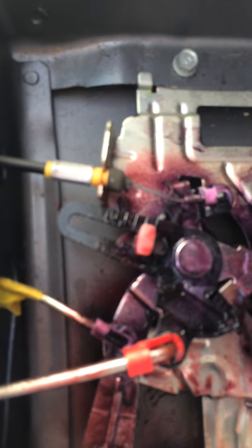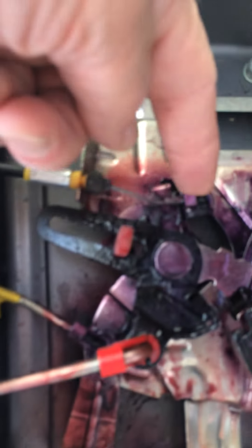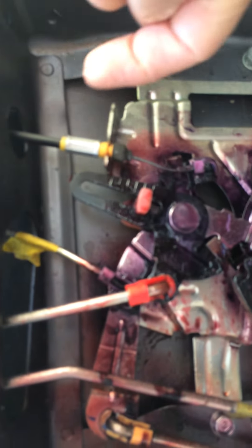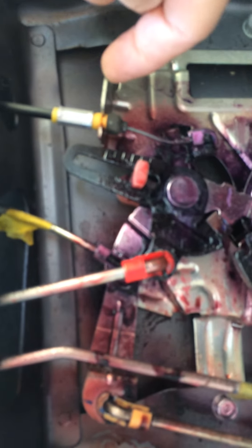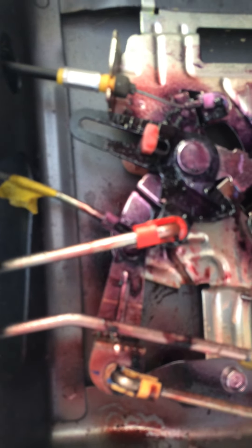Really, all you need to do is essentially shorten that cable so that it pulls this actuator a little bit better. By bending that tab back to the left, it essentially shortens the cable so that this actually gets pulled a little further and the latch pops right open.